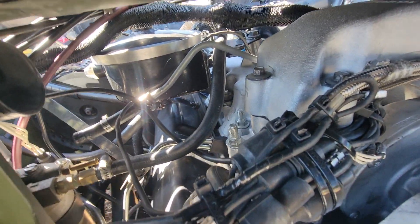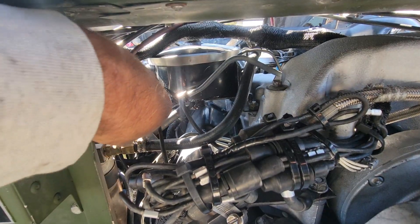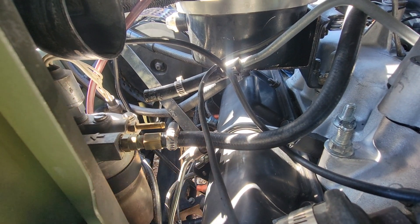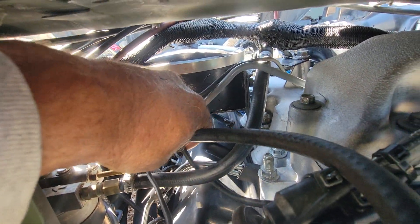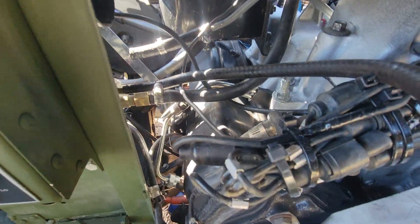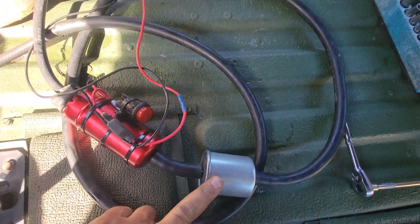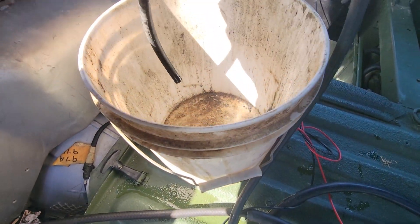This is how I pull fuel from the fuel tank. I don't crank it. I disconnect the outlet to the filter right here, connect my hose — I've got this hose that connects and goes into a cheap little pump with a filter, and the outlet goes into a bucket.